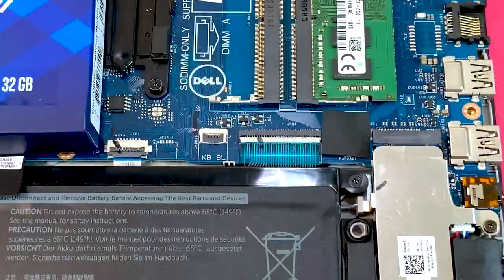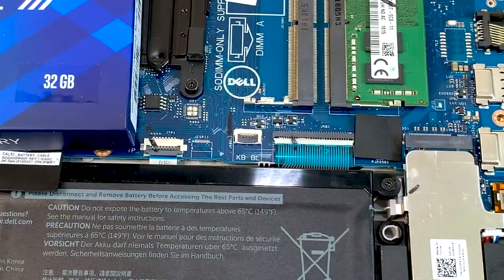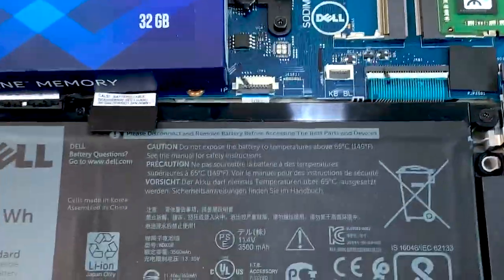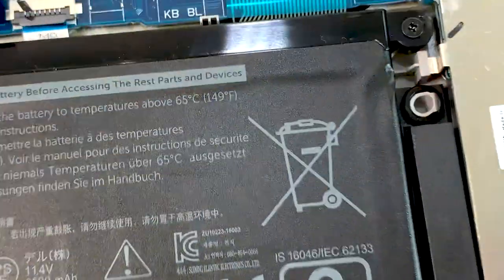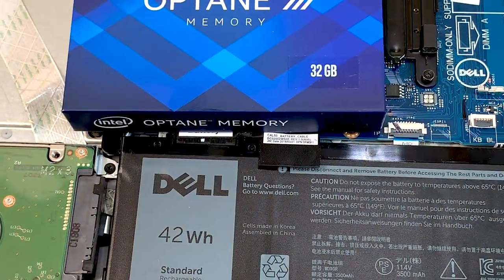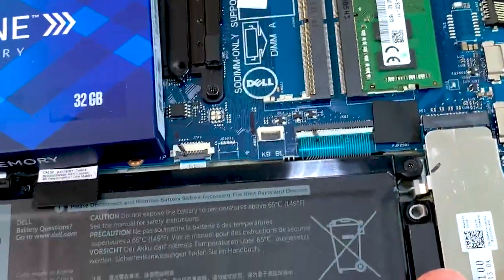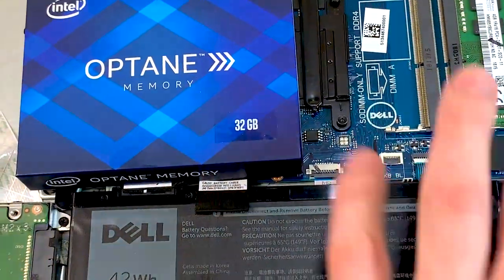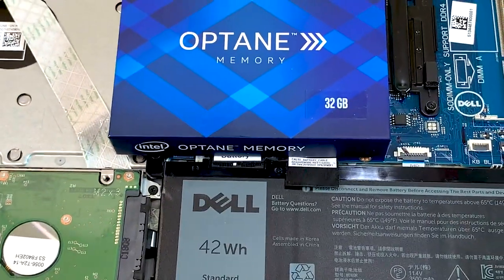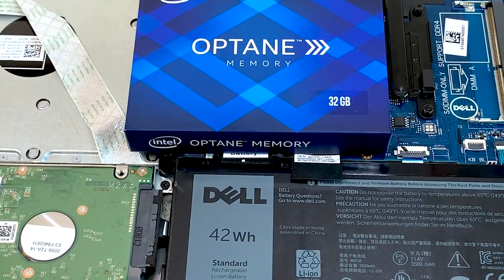If you're RAM limited, it's going to be better than writing to your hard disk because it has lower latency. It's the closest thing we have to RAM. So if you can't afford more RAM, just buy one of these inexpensive Optane sticks — it'll boost your RAM, boost the speed of your hard drive, or serve as a super-fast primary drive. Also, you may see laptops labelled i5, i7, or i9 plus — the 'plus' means Optane capable, meaning the laptop can use Optane to boost RAM, boost the hard drive, and be used as a primary drive. Optane explained — it is the best stuff you can get, but please come down in price!